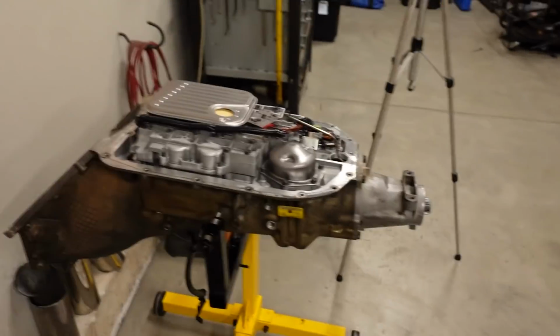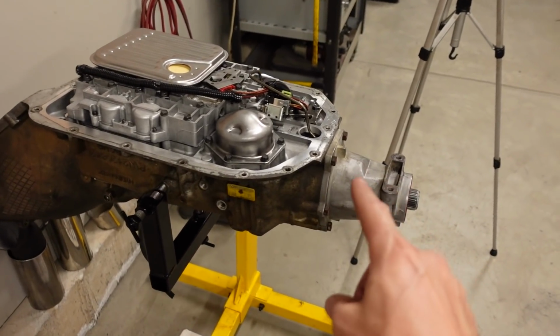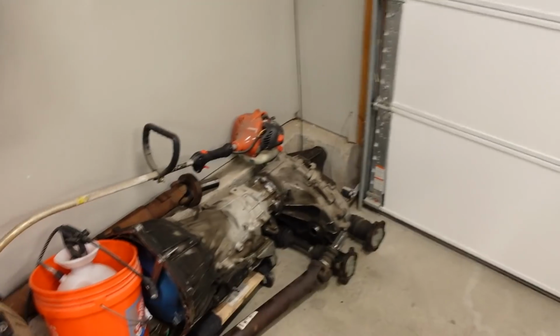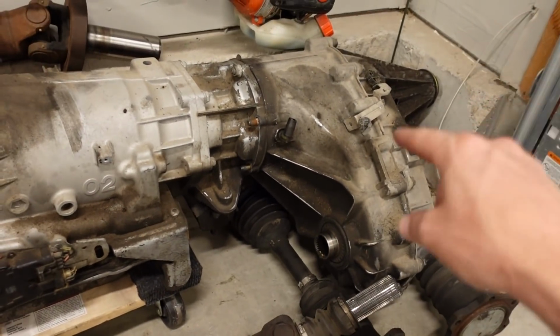We're going to be pumping about 700 pound-feet of torque through this thing for now, and then long term, just so you guys are on the same page, I'm probably not going to be using this unit because the 547 big block, I think, I would have to redo everything here. But this transmission is not going to go to waste, because if I just pop off the tail housing there, take everything back apart, and switch the output shaft, I can then hook that up to, which, by the way, guys, this is probably a sneak peek. I'm not quite sure what order these videos are going to drop. But my ultimate goal is to have that 4L80 in the step side outside attached to this cool little transfer case right here. And if you guys know transfer cases, you'll know that there's something missing right here, which actually makes this a really cool transfer case.